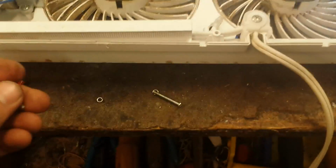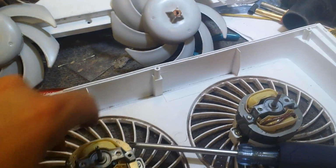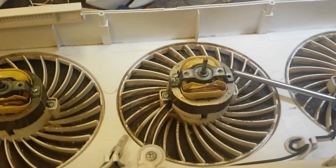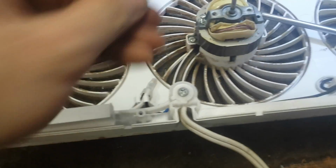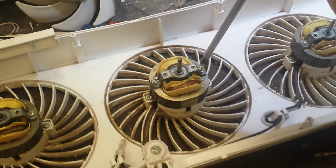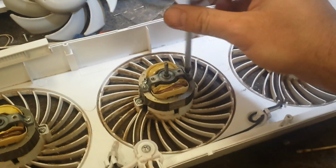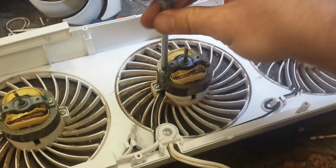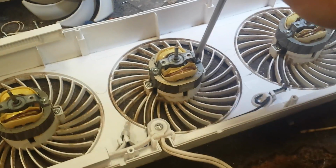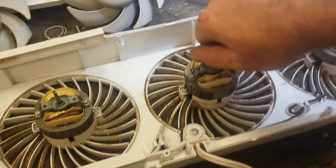And then if I can get a hold of the screws down here. Don't lose those lock washers. Work the screws on. Get the second one up there. Okie dokie. Just going to get our number 2 and put the screws back in there. Tighten them down. Seat them with as little pressure as possible until you get them both seated, then crank them down. And to seat the bearing, I'll usually rotate it in a motion to seat it, and then do a spin check.